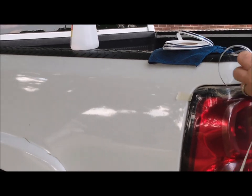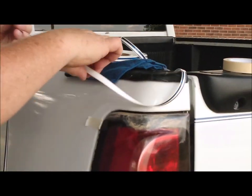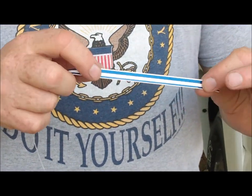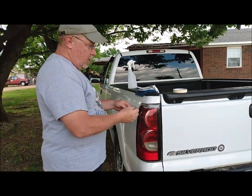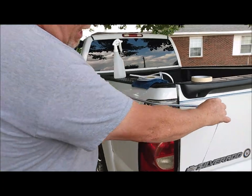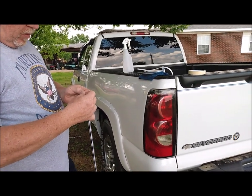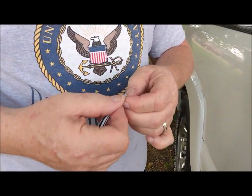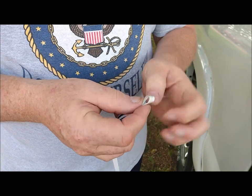My knife is on the other side of the truck, so hold on just a second. Now, I'm not sure that I really need to say this, but be careful you don't cut yourself — that's the public service announcement part of the video. You'll notice that the stripe has a thick one on top and a thinner stripe on the bottom. It's really easy to put it on upside down and then it won't match what you've already done, so be careful. These are two separate stripes, and they're actually held at an equal distance by a clear plastic.